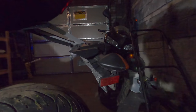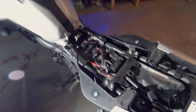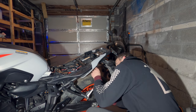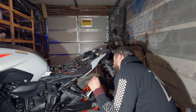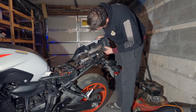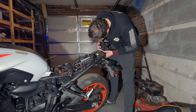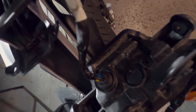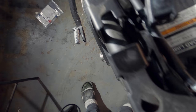There's a zip tie underneath, and you have two bolts on the left and right side of the underside of your bike that you have to remove — they're attached to a mud guard. Assuming you're removing your license plate holder, you'll have to remove that to get everything out. Here you can see me fiddling with the side fairing bolts. Once I removed all the bolts holding the side fairings in place and popped out the plastic push screws, I removed the side fairings and then the tail light from the rear. Follow the wire all the way up — there's a bunch of connectors and you pull the entire wire out.